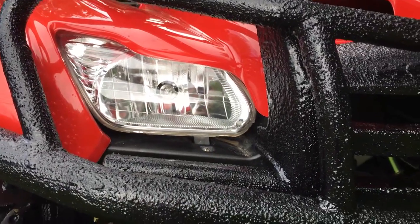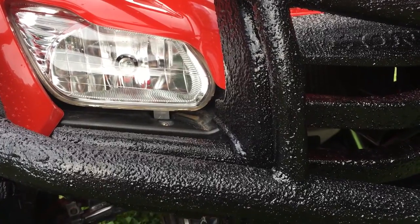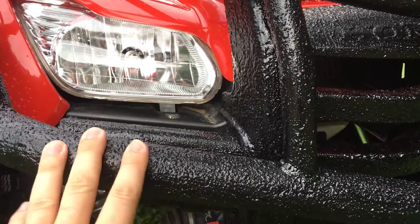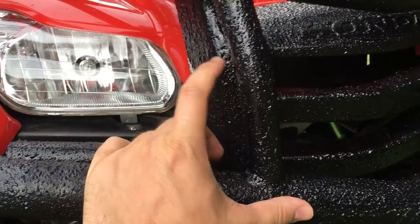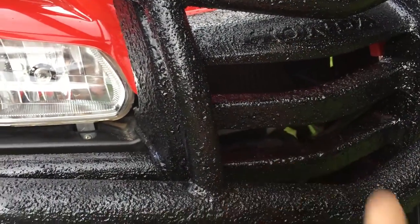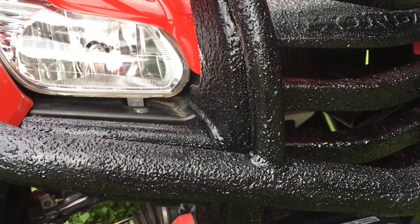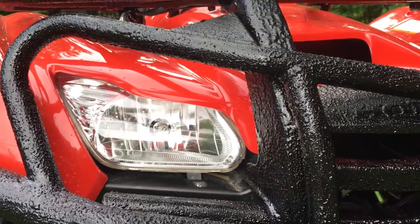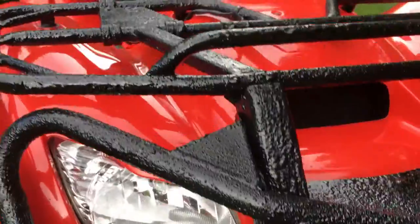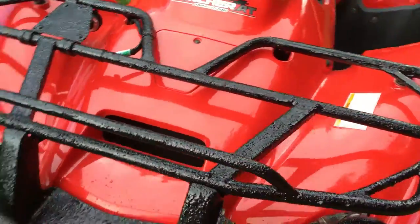It's kind of like rubberized undercoating, only probably tougher. It turned out real good. We sanded all the gloss finish off all the surfaces, including the plastic grill back here — sanded that down to get a rough edge on it. That's what you've got to do. Then you clean it up and you're ready to brush on the Herculiner with paint brushes.